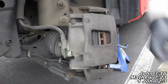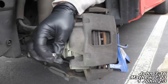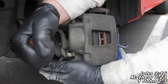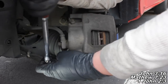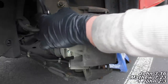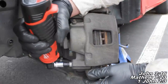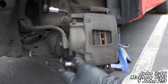We're going to next remove these caliper bolts — it's going to be a 3/8 drive hex socket. The actual hex socket is going to be a 3/8; it's not going to be a metric socket. I was looking for a 9mm hex socket and I was not able to find it, so I had to go buy a 3/8 one, which is apparently just the equivalent of the 9mm. For whatever reason they don't sell a 9mm hex socket at least where I was looking. Now I've got my new cordless ratchet here — it saves quite a bit of time.